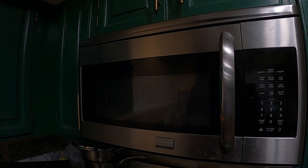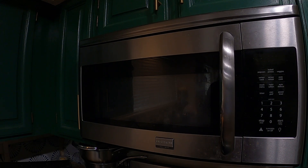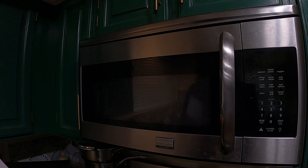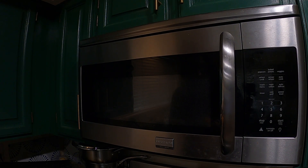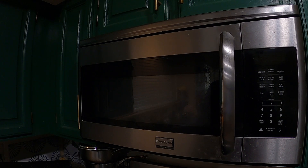We've concluded the test. Based on this detector, this microwave is not leaking any major amounts of radiation. The max reading we got was 0.2 for a brief second. The manual indicates that anything from 0 to 5 on the reading is safe, so we're well within the safe range. The microwave should still be safe and not leaking through the seals.